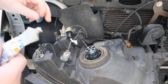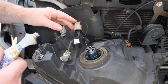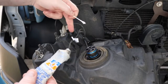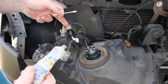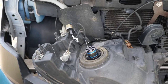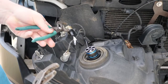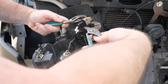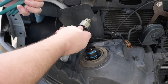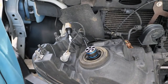Real quick — this connector here goes together really tight; I could not do it by hand. What I'd recommend is get a Q-tip and some dielectric grease, smear the inside of the black connector, and pack the electrical terminals on the gray connector. It electrically insulates, isolates, protects from corrosion, and also provides a little lubrication. I still had to use a couple pairs of channel locks to slowly and gently squeeze it together and rock it side to side until it finally clicked.